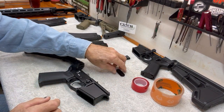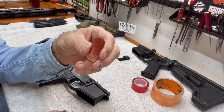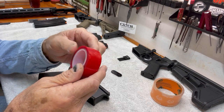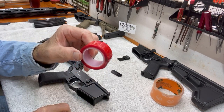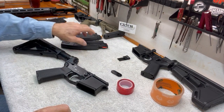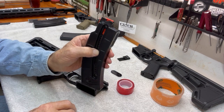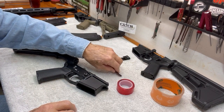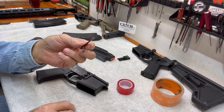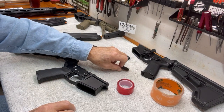I bought two of them. On this second shim, I decided to use a different two-sided tape — this is some tape I got from the auto parts store, and it's thicker than what was on there originally, so I'm hoping that will make up the difference. My homemade shim is 2.75 millimeters, and this one with the other tape measures in at about 2.70, so it's really close, and I'm hoping that will tighten it up a bit.